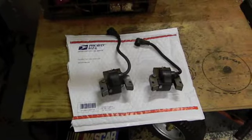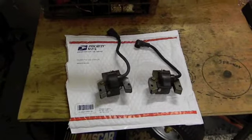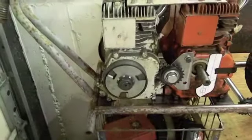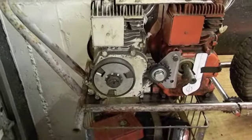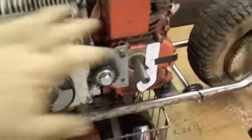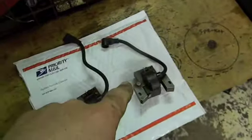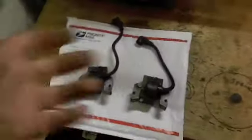When we tear into this engine, we'll put these on and have them running. The orange engine we started up before we started working — that was fine. This white engine I started up last maybe two years ago; the gas was bad when it ran, but before that it ran fine. When we break the engines down to paint them and put gaskets on, we'll swap the coils over. If it doesn't start then, I'll know these are bad.